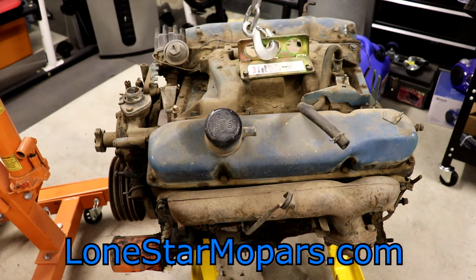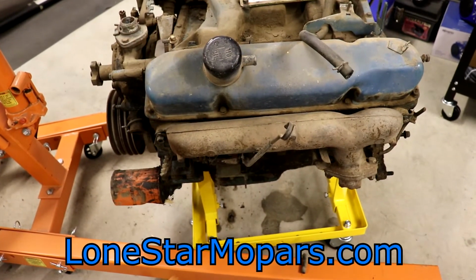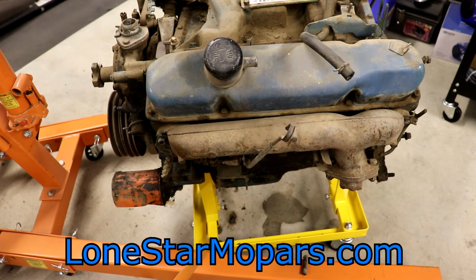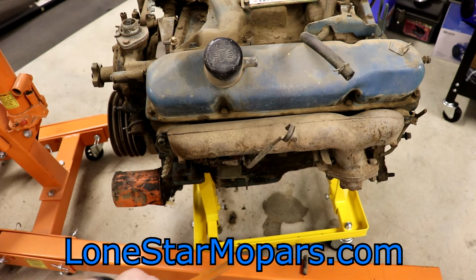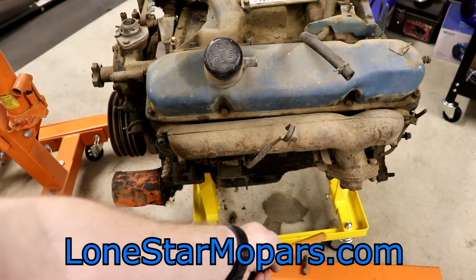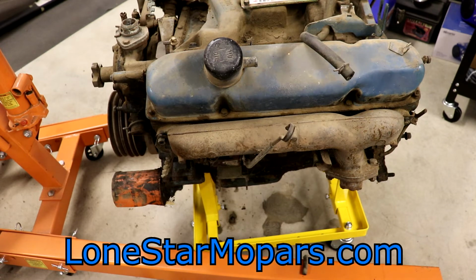Again, for the 440 here, it was the farthest outboard. Let me tilt you down so you can see what I'm talking about. You can see where I've got the bolts from the casters coming up, the stud, and then we've got the flat lock and nut. That point there and this point here with my orange pointy stick indicate the farthest outboard we could go. We do have a section here. There's only one slot here, and yet here there are 2 pre-drilled holes, so there's 3 on one side and 2 on the other. It's kind of a strange setup really, but I guess they based it off of engine measurements. So it is what it is.